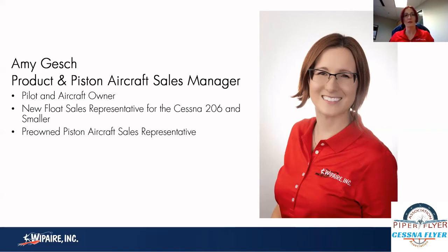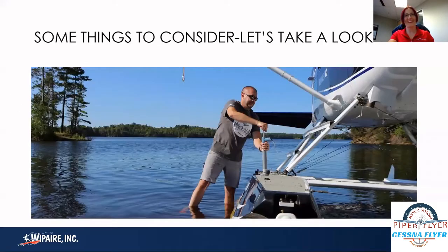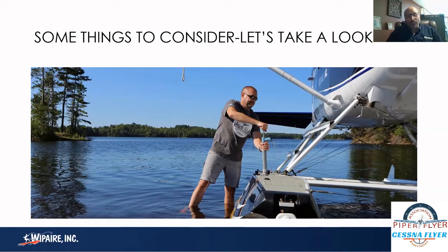I'm personally a pilot and aircraft owner. We'll get started with some of the maintenance side — you're going to hear from Kurt first. Some of this depends on how your floats were stored — inside in a heated environment or outside in a cold winter environment. The first thing to do when you get them to wherever you're going to install them is to look them over really well and look for damage that may have happened during storage. If other items were moved around the floats, things can bump into them, dent the skin, or maybe even puncture the skin.